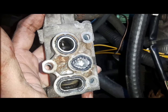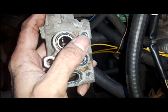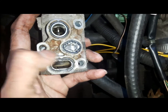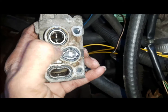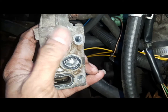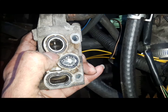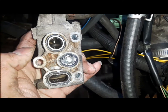So one way to resolve it, which I'll try, is to just shut off this one — put an aluminum foil in this hole and then install it back. So coolant can still flow, but air cannot go; air cannot get sucked from the intake. Just shut off this channel. The cold start shouldn't jump to two or three thousand RPM. It should just go up to fifteen hundred, two thousand, and slowly come down to normal idle.